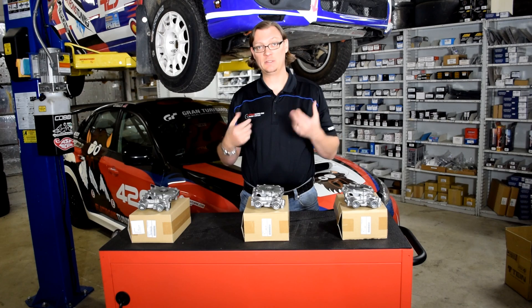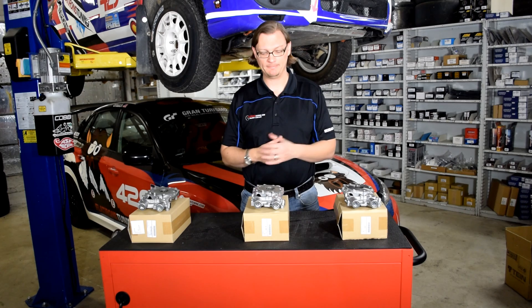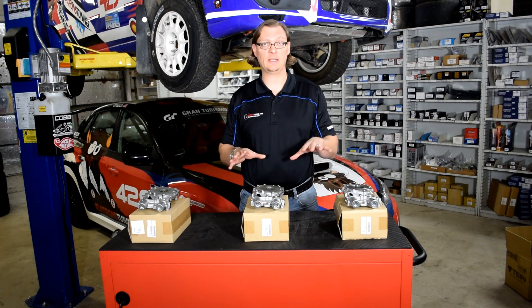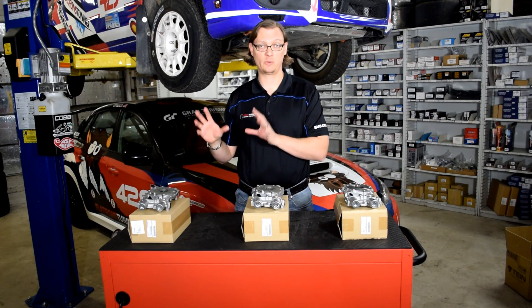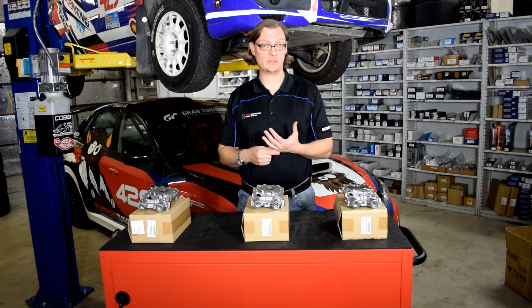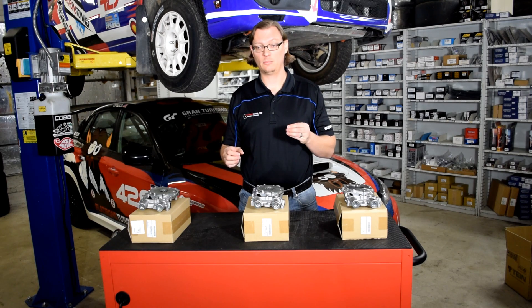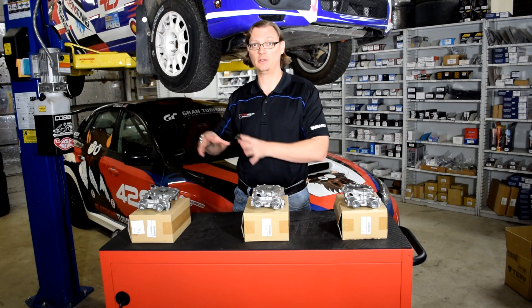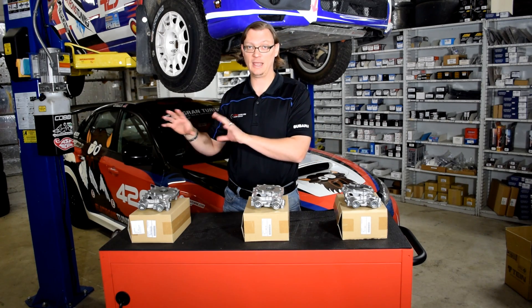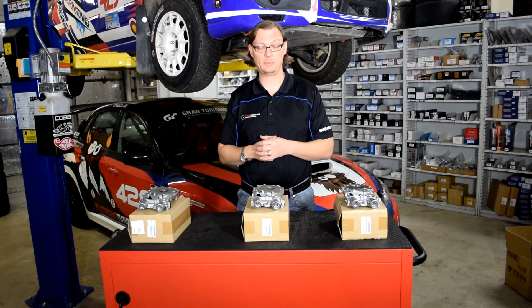I can't give you a specific answer, but I can give you general oil theory. Before I go into that, one important thing: if you're wanting to make a change like that, monitoring the oil pressure is crucial — at least with a gauge, if not actually doing data logging. Ideally, get a baseline before you make the change and then see what the pressure is doing after, so you can confirm you're getting the pressure you need at the right RPM.